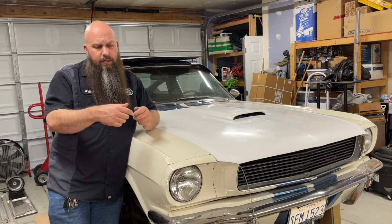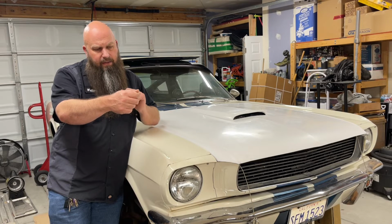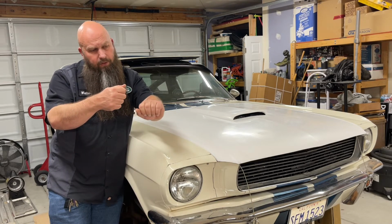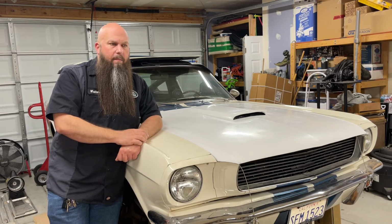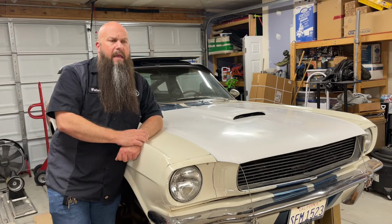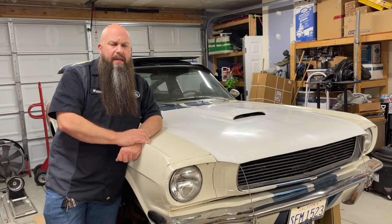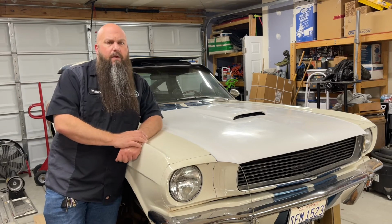And what you have to do is grab the cable and the arm, and you have to pull the arm towards the front of the car, disconnect the cable, okay? It's not the easiest thing to do by yourself, but you can do it. And once you've got that disconnected, then you can slide the arm back, and the arm drops out of the transmission crossmember.